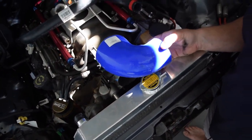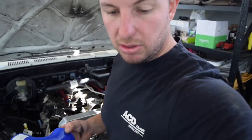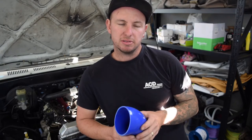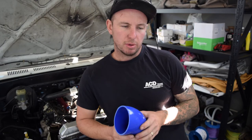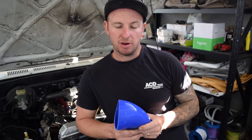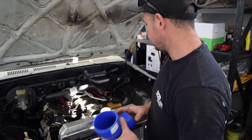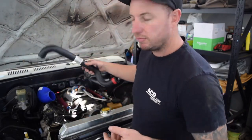Right now the throttle body to the radiator is 70mm. If the engine mounts and everything were right at the beginning of the conversion it would have been about 85 to 90mm - that would have been nice to fit - but that's not the case anymore.